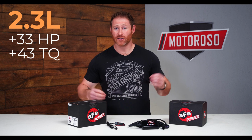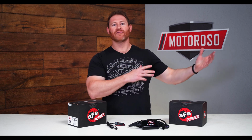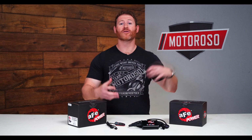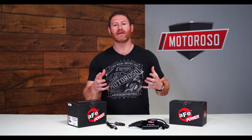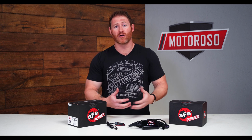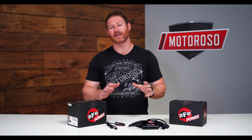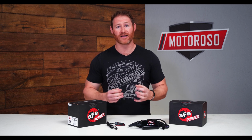Now keep in mind, these are dyno-proven gains, and these are real horsepower numbers. And when we look at 275 and 305 from the factory, those are the crank numbers. And there's always going to be about a 15% drivetrain loss, which means that when you're gaining 33 horsepower on the 4, you're gaining more than 20% power and torque. And out of a product that costs about $500, that is incredible bang for the buck, and you don't usually find value that good in the aftermarket.